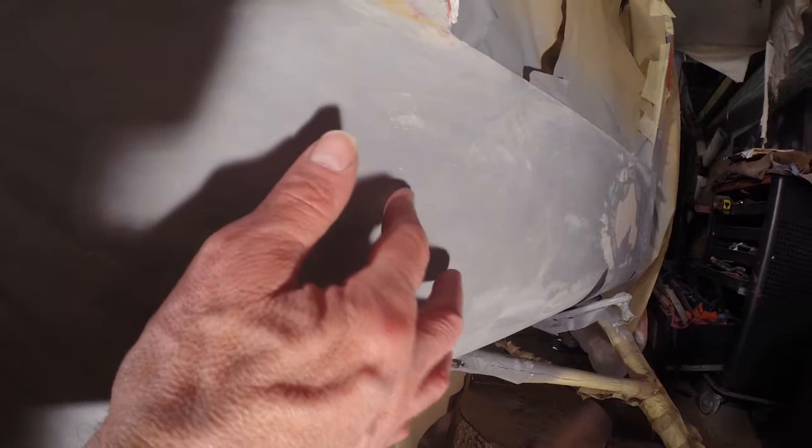What I am seeing now though is that with a couple of layers of primer on there, I had the woodgrain poking through. But a couple of layers now flatted back seems to be getting rid of the woodgrain - you can just see a little bit of it there. But I don't think that's textured as such. You can just see where the new coat has filled in the gaps and then the darker bit underneath - a tiny little bit there look. But I think the two-pack builds even higher as well, so those tiny bits I can take out with the two-pack and flatten that back. There's going to be at least two, maybe three coats of two-pack on here, flatted back between each coat.